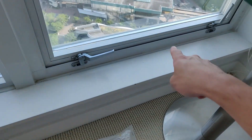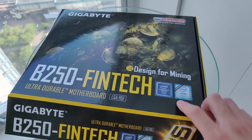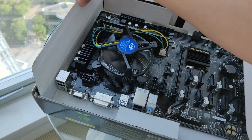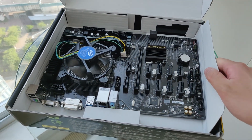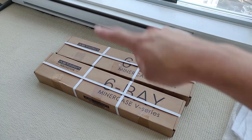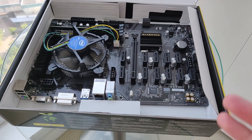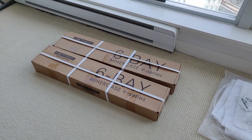I also picked up a 12 PCIe motherboard — this is a Gigabyte B250 FinTech that I got on Craigslist. It came with an 8 gigabyte stick of RAM and an Intel Pentium G4400 CPU, all for about $100 Canadian. With this motherboard I can fit it across these two mining frames and run 12 cards. I normally like setting up six to eight GPU rigs, but this time I want to utilize a 12 PCIe board and see how that works.